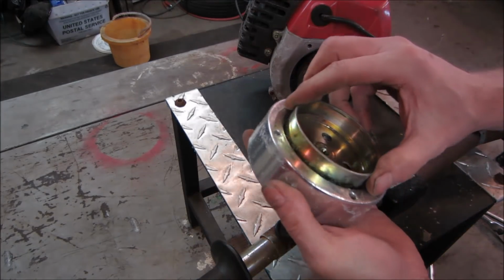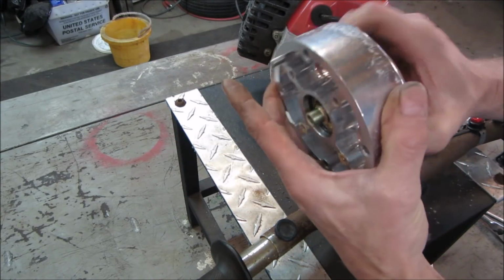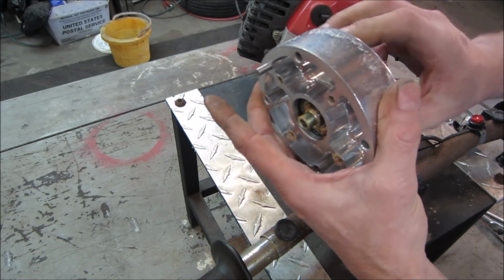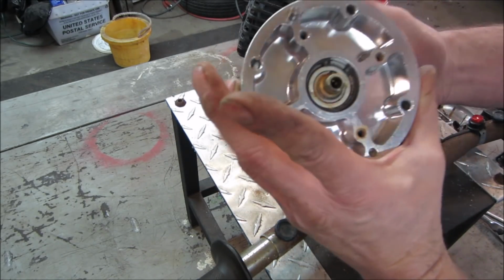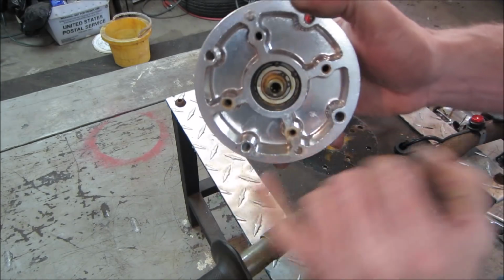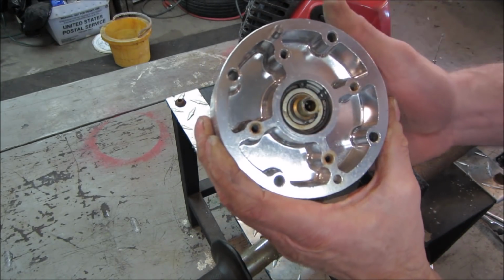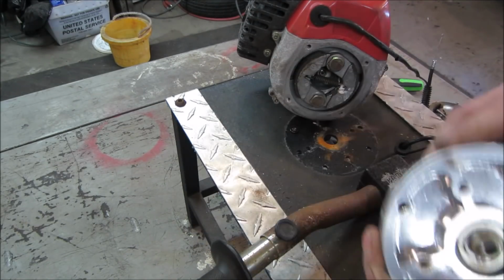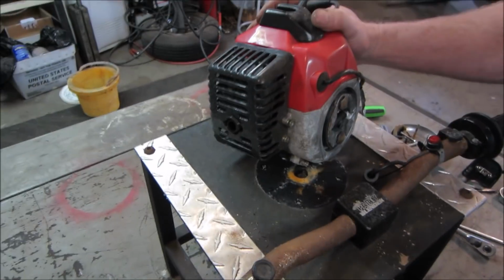Regular clutch, and that's locked up on the bearing. Oh, there it goes. Just need a little bit of love. She's a tad growly though. You can see where water has gotten down inside there. Let's go blow that out with compressed air, and we'll soak some oil inside there. How's that motor look?